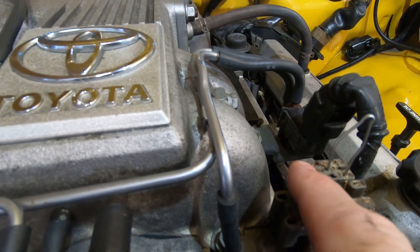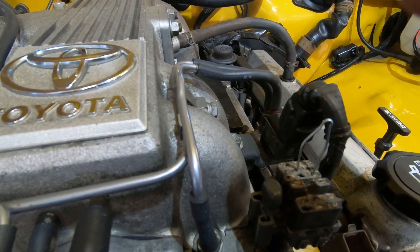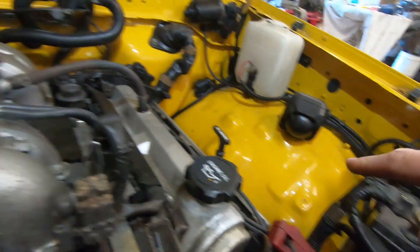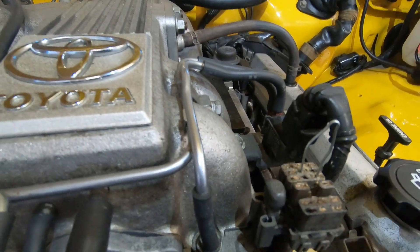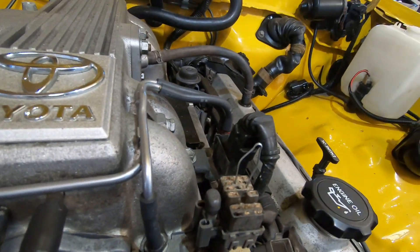Over here is the W, or the check light. When I bridge these two it should output a code on the check light wire — I'd put it to the power and to the check light. Unfortunately that's not wired correctly, it's not working, and there's no check light on the dash. So if this ECU has got any fault codes, I can't presently read them — but we're not about that today.